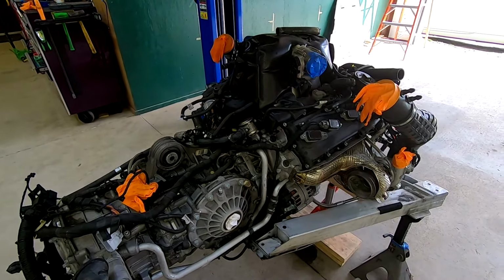That's what holds down the coil pack. Pretty much like any other engine. We do have a little rubber piece down there, right below it. That spaces it off. And you don't wanna accidentally back that out, because that's gonna be a bad time. That's gonna lead you to where we are now, because you can't fix that in car. So make sure you don't over torque going in, and you won't have that problem coming out, or you shouldn't have that problem coming out.